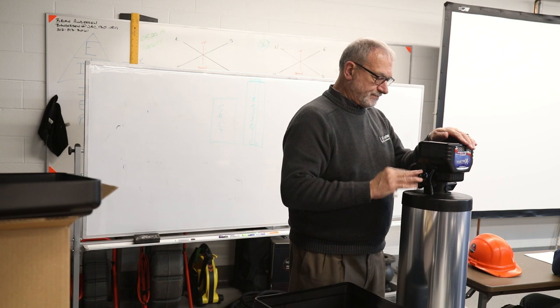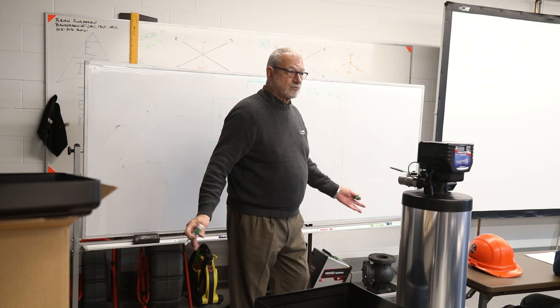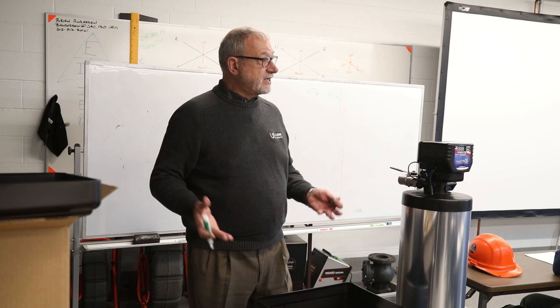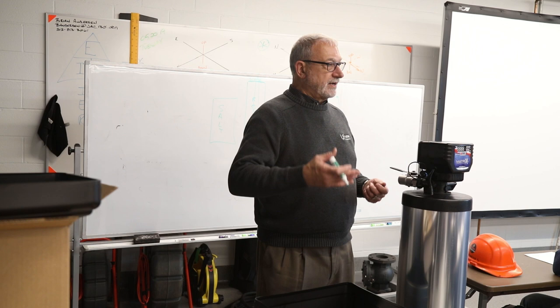This controls all the cycles of operation of this piece of equipment. Just to go back and understand what happens: water that is hard has calcium and magnesium — that's what makes water hard. When water containing calcium and magnesium is heated, the calcium and magnesium precipitate; they literally fall out of solution and it causes them to stick.